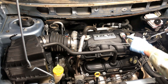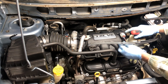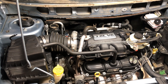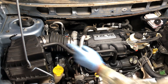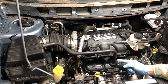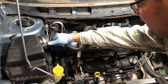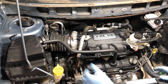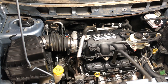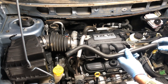While we're moving along here we'll go ahead and do our intake sensor. You have that red tab — push it out, then press on the release tab and pull backwards, and we have that released. Next we'll tackle the line that comes from our airbox into our valve cover. Rather than yanking and cracking the hose, start on that side to disconnect it, then turn the pipe to break it free, lift up while wiggling, and just like that we get the pipe off without breaking it.